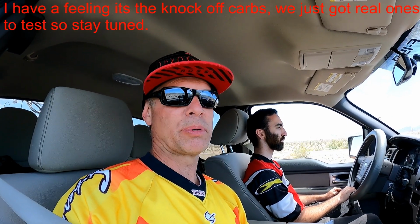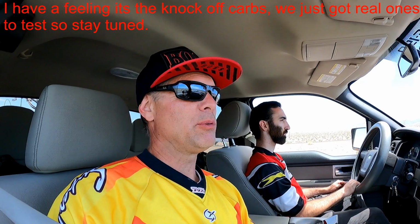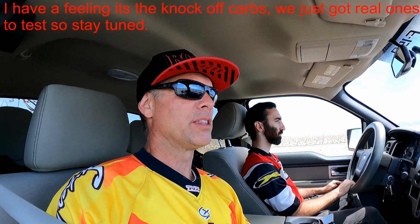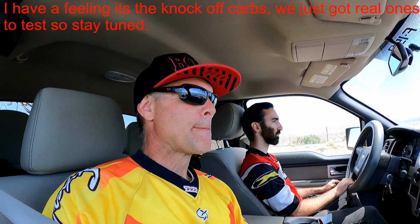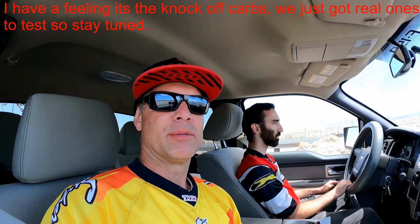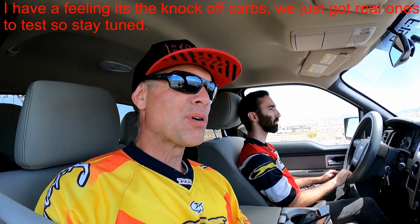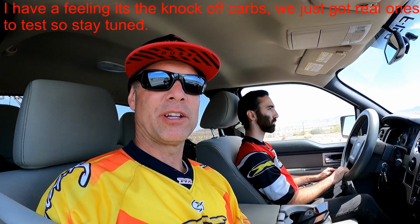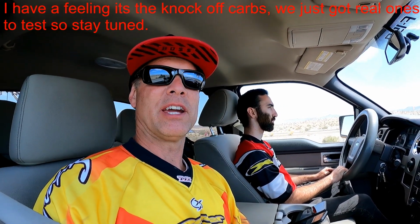And I know from experience in building these a lot, these Cubs and Super Cubs, you can throw tons and tons of fuel at them and they will still run and they will get on the pipe and they will not sputter. I run as large as 185s in them and they run fine. Probably most of them, depending on the porting, will run in the 165 to 170 area.